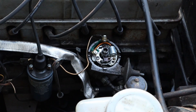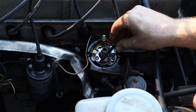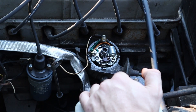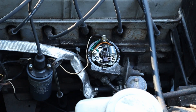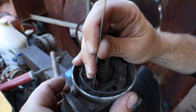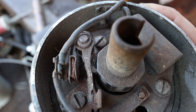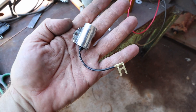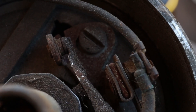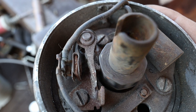Such as ease of maintenance. Because there's not a lot going on in a points ignition system, maintenance really isn't that big of a deal once you have some experience. Proper maintenance really just boils down to periodic inspections to make sure that your gap is still in spec and resetting if necessary, as well as replacing or filing your point contacts when they eventually wear out. A good tip: if you feel like you're burning through those contact points a little too quickly, pay special attention to your condenser. The condenser limits the arcing between the point's contacts, which greatly extends the life of your points. If the condenser goes out, your points won't be far behind it.